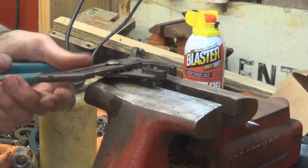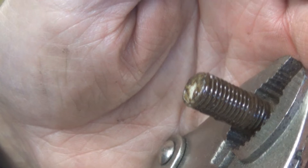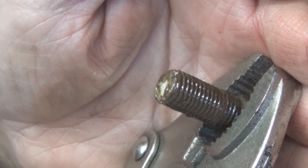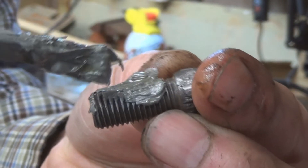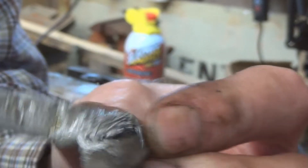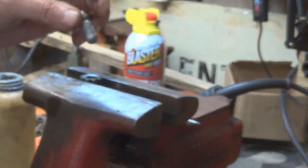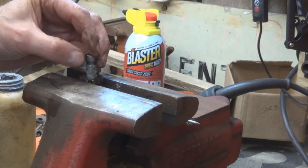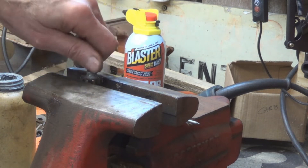I got it out. She's rusty all the way down, so we'll take it to the wire wheel and clean it up, put some anti-seize on there, and we'll be good to go. We're putting some anti-seize on it — it's a combination of aluminum and grease — which will keep it from freezing up inside. Look at that, it goes in just like it was meant to, all the way down.